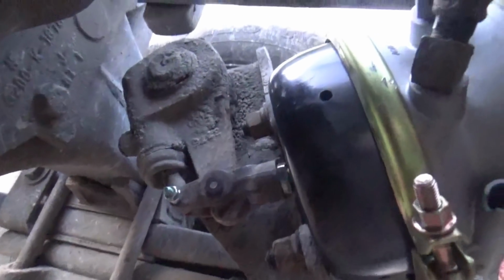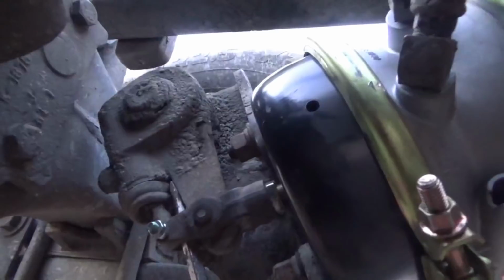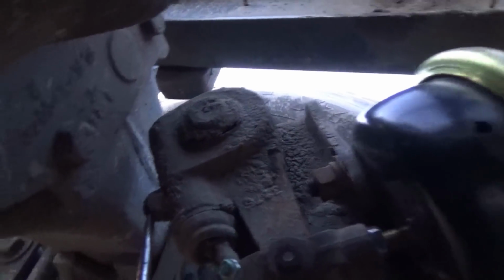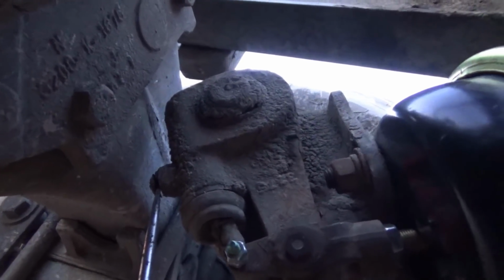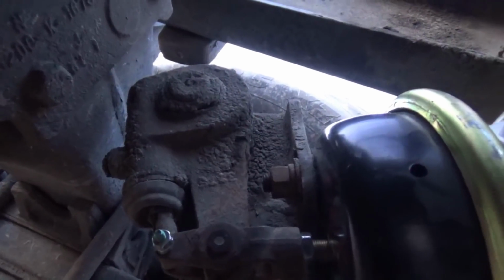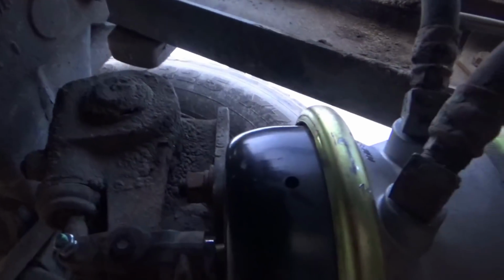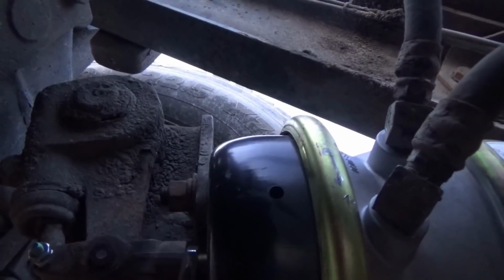I have got my spring brake released, and I can check my adjustment now. I know it's loose, but there are two ways of adjusting it. One, I can just tighten the brakes all the way down and then lift this little cap up here on this little ratcheting thing. I can lift that up, and then turn the adjusting screw backwards half a turn, and that's a good preset adjustment. Not real accurate, but it's good enough. Or I can put this big screwdriver right in here and pull this out all the way out till it stops, until it's hard, and then adjust my brake until I've got only about 1 1/4 to 1.5 inches of rod coming out.